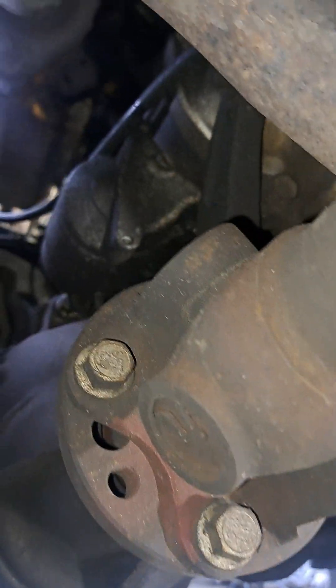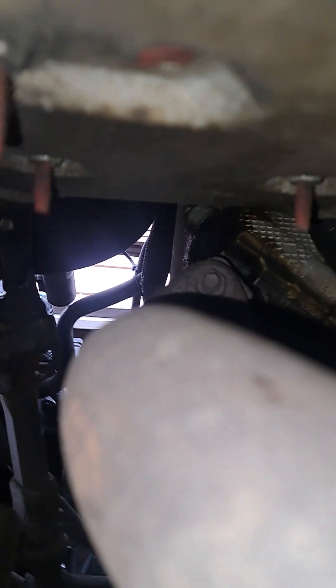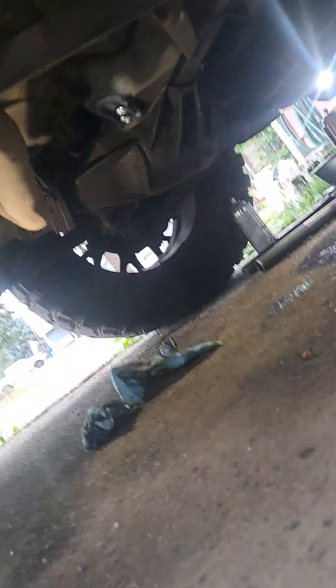You have a code for the O2 sensor, upstream and downstream. There is no upstream O2 sensor anywhere here — it would be right in around this pipe, but there's nothing. That pipe comes down and crosses over to that side. Let me walk over and change sides so I can show you. I don't see an upstream O2 sensor on this side either.